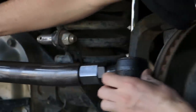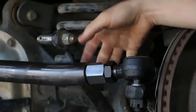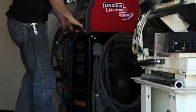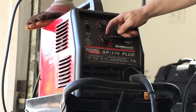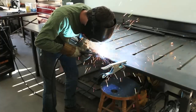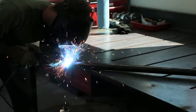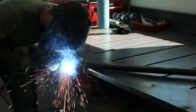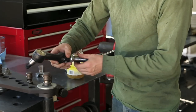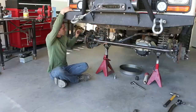Now that we know we have adequate clearance with our tie rod, we'll set our welding bungs to a nice flat position like we discussed earlier. Then we'll begin by tacking about four tacks on each one. Then we can remove the tie rod and weld these solid on the bench. Once you have your weld bungs in place and welded, cool them down, then go ahead and begin threading your tie rod ends back into your tie rod. With your tie rod all welded up and put back in place, we can move on to the drag link.